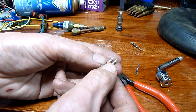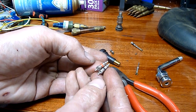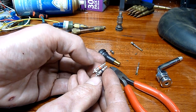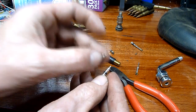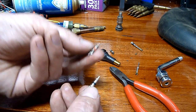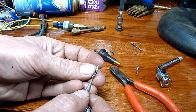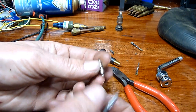The colour of the bands determines the quality and type of plastic seal. I think refrigeration ones are red and normal air type tyre valves are black, so this red one is likely a refrigeration stem. There's a whole data sheet on seal types for Schrader valves covering refrigeration, air conditioning, shock absorbers, oil handling — plenty of applications. But the actual style doesn't really change.